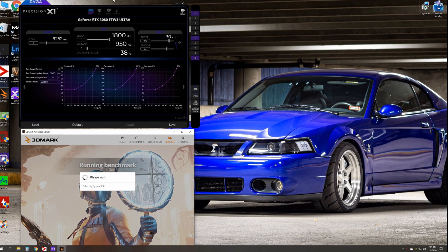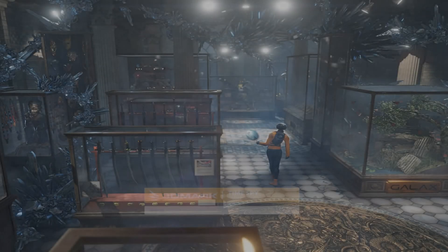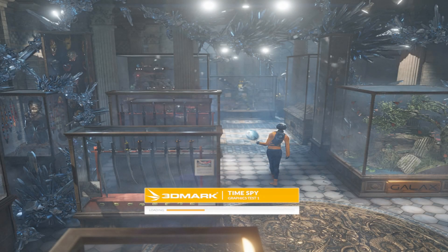Now, it's worth saying that even though it's supposed to run at 1800, with the way the NVIDIA boost works, it's actually going to more or less run the card at 1900. It automatically overclocks the card for you, even if you don't tell it to, essentially.